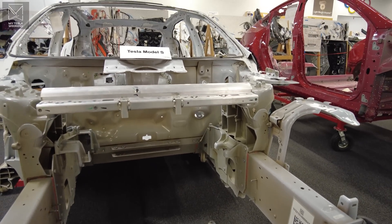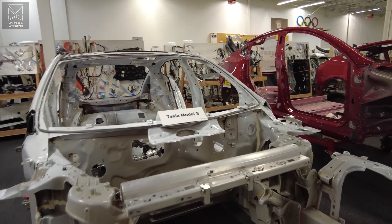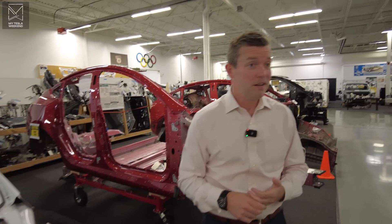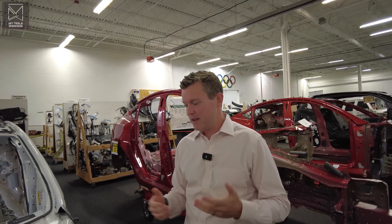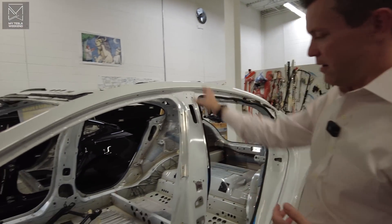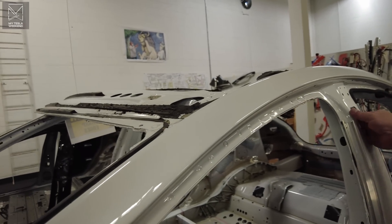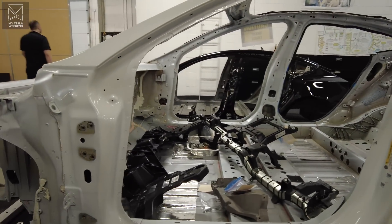They're putting three internal permanent magnet motors in this thing, and it's an aluminum body. Making an aluminum body is not groundbreaking — Audi in the mid-90s made the D3 platform, which was over 95% aluminum. As different crash requirements have been enacted by regulatory bodies, there's actually more steel in aluminum bodies now. Inside the A-pillar you'll typically have a boron or hot-pressed steel for roof crush, and sometimes additional strengthening for a small overlap rigid barrier.